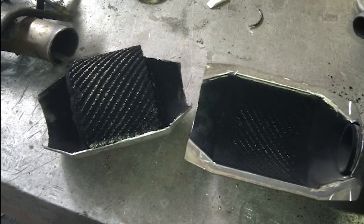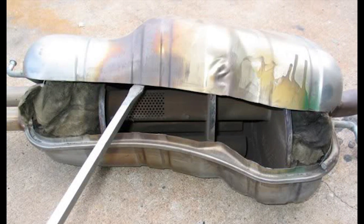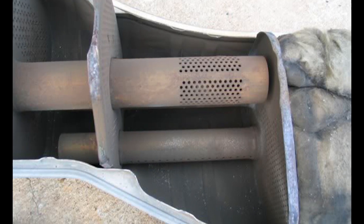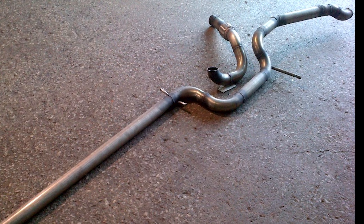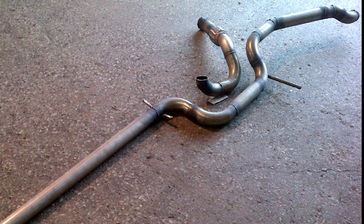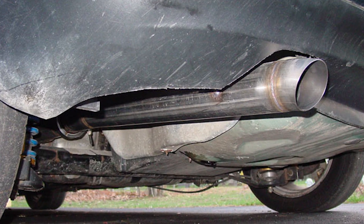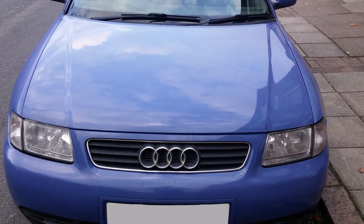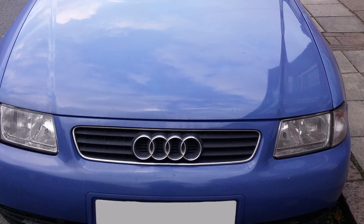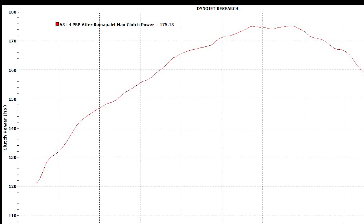Next, let's look at the exhaust. The stock exhaust on my car is full of restrictions — in the downpipe, the centre silencer, and the muffler. Ideally you'd run a straight pipe from the turbo straight out the back, though that's not always possible. Removing restrictions with a performance exhaust or a straight-through downpipe helps turbo spool-up time and gets as much air volume through the engine as quickly as possible. With all these upgrades and a remap to match, I could be looking at 175 to 200 brake horsepower.